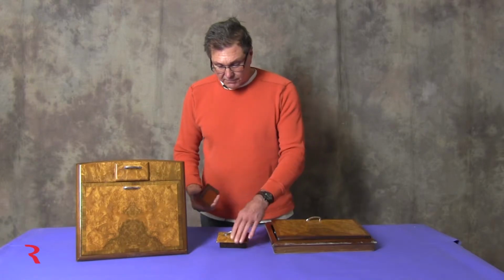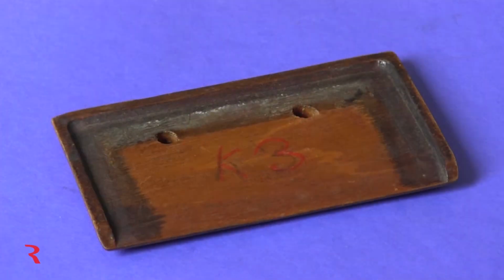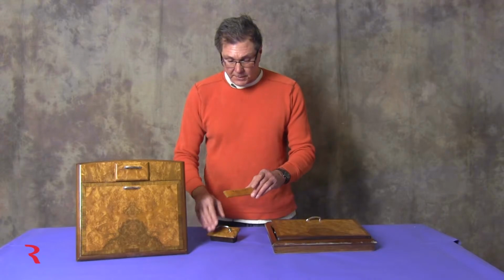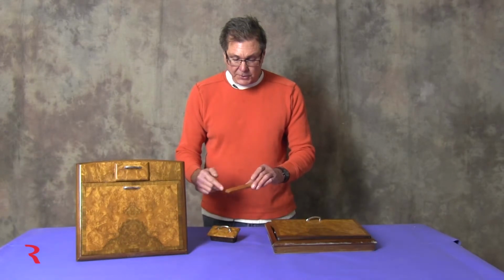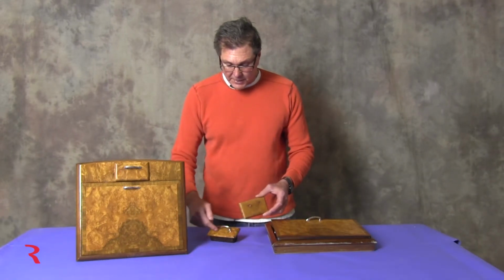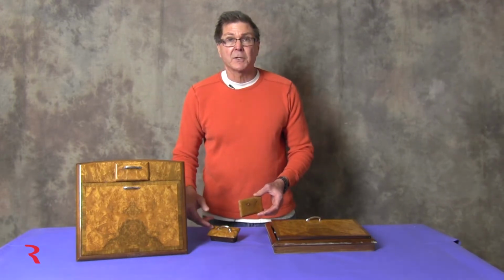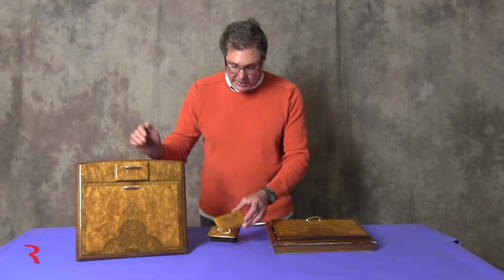The way these ashtray fascias are made, they take a solid piece of mahogany, mill out a back pocket, and then it attaches over the front of this bucket. And then screws hold the handle on and hold the fascia on. But because the grain's going like this, and they have these two large holes in here, it's not uncommon that you see warpage. A little bit more uncommon is this break across the wood. So we have to make a new one, then veneer it to match that.